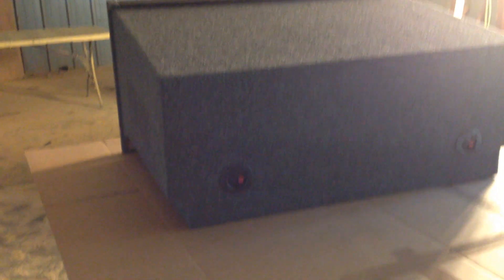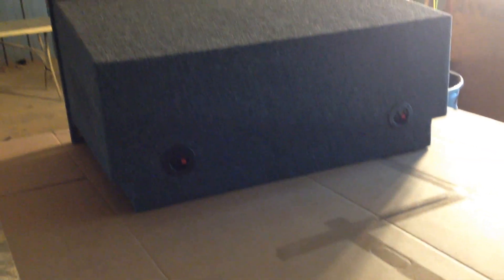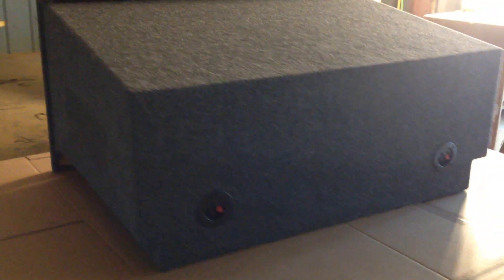Come over to the side — as you can see we've got a tapered top. This tapered top is just so we can take up as much space as possible because it tapers as you slide the box back. On the back side we've got these little hump riders because on the bottom left and bottom right portion of the trunk you've got those little humps right by the wheel wells. That's made to ride over them so we can get as much width as possible — the bottom is 32 inches and the top is 36 inches.